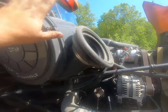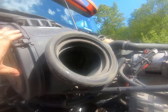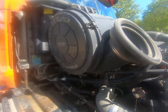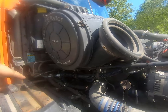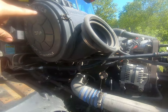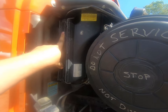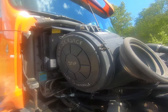Check your air filter — if it's time to change it, replace it. I have a permanent reusable washable one in here from Fleet Air Filters — link to that below, and I have a video on servicing these. I'm not a fan of blowing these things out; if you watch that other video I'll explain why. Cabin air filter — this is not due for service yet, it's clean, so we'll just leave it alone so we don't let any contaminants in there.